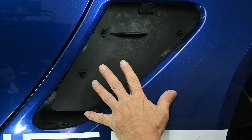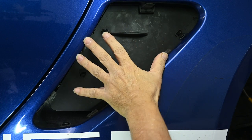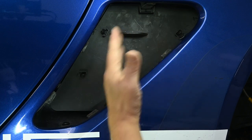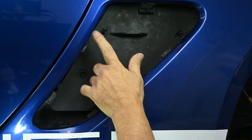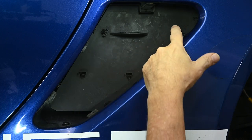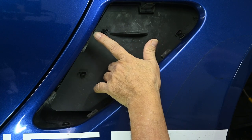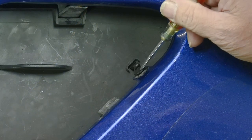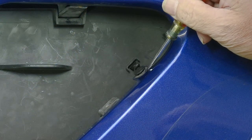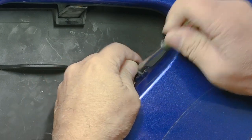You may have several reasons for removing this grill and subframe, and one of those is to replace it with a carbon fiber version or a different shaped version. A lot of those have a frame that screws into place here and doesn't use these same little mounting knobs. To remove the mounting knobs, you remove them and then run screws through that new subframe into the holes in the sheet metal. You've got the upper part of the button and the lower part that sits against the sheet metal — just slide a screwdriver in there, apply the same twisting motion, and it pops right out.